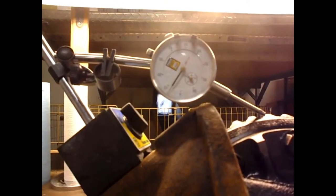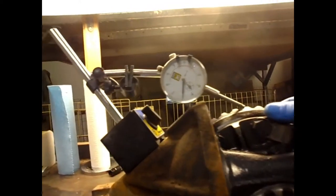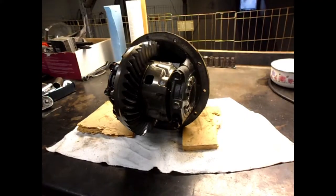We're back with the '92 Hilux — it's been about a week. I got all my parts ordered up. We're going to check the backlash on the old one — this is the old one with the broken tooth — so that's sitting at zero, and now that's at eight thou. We're getting about 8 thou of backlash right now before I touch anything, which is kind of odd because it seemed to have a lot more backlash with the driveshaft in.